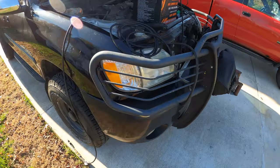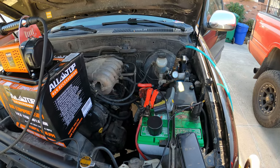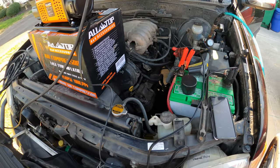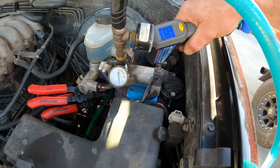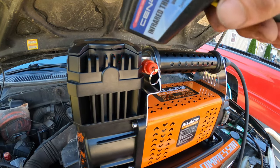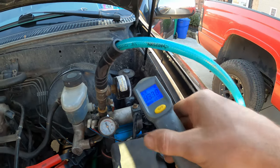I don't know if I'd call that double the pace, but the volume is going to start slowing down as pressure increases, so that one probably would have taken a lot longer to get up to 38. Having two compressors hooked up to one battery was a pretty big load — starting your truck will pump up considerably faster with a charging voltage of 14.5 volts. Temperature check: the ARB is 130°F on the outlet block; the All-Top is 108°F. Cylinder head: ARB hit 150°F, All-Top only 136°F — the ARB actually ran hotter, surprisingly.